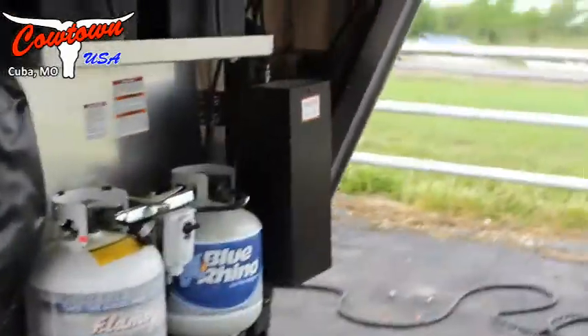I'm really big on the necks of these trailers. I saw a truck the other day that ran into another truck pulling a trailer, and the trailer ended up on top of the truck because the hitch didn't hold. This is an all-aluminum trailer, but they all have aluminum or steel frame necks. The steel frame on this neck runs all the way back and is plated all the way through. It's not only welded — this neck is welded and bolted.